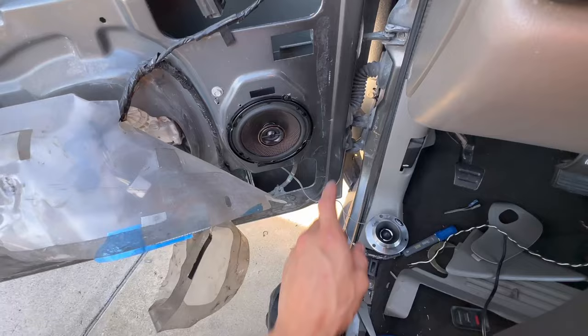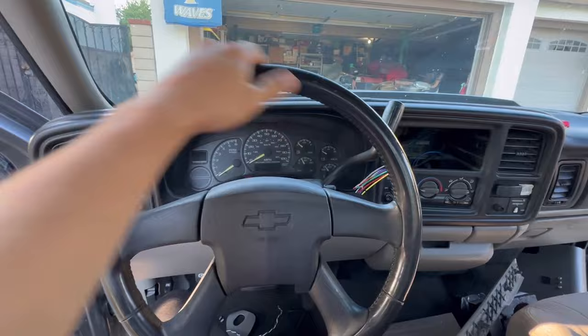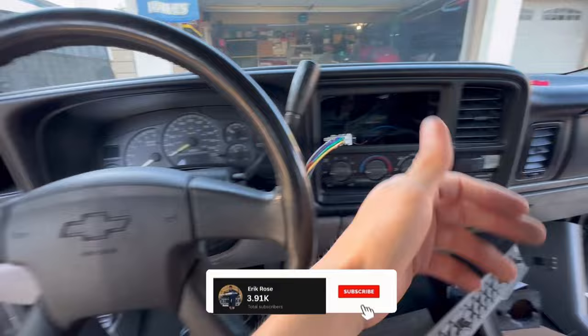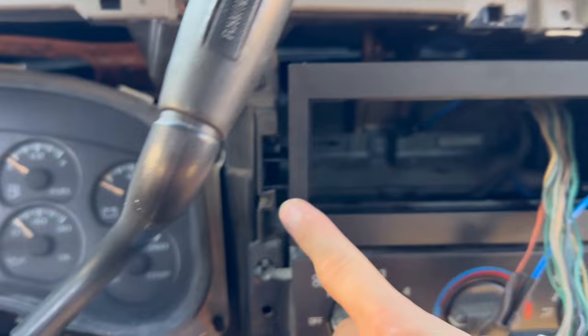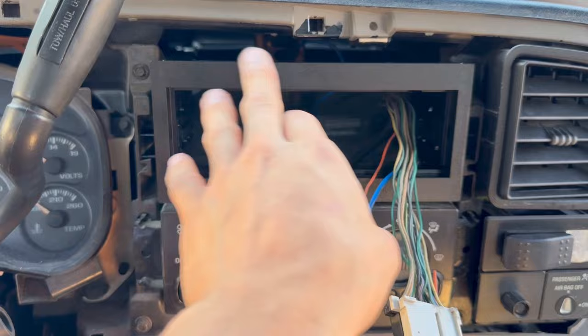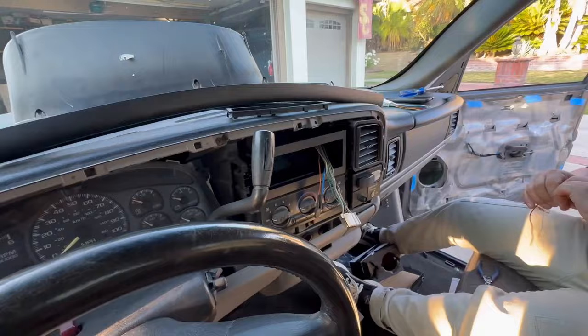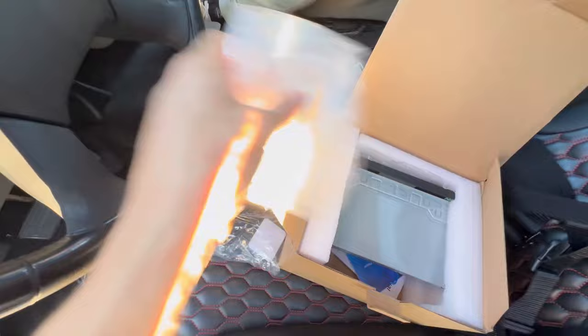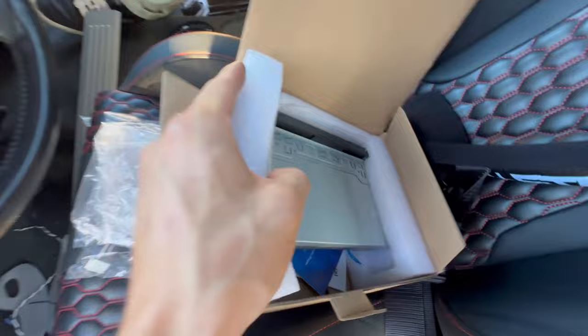Before finishing that other side, we want to go ahead and put the head unit in first, just to make sure we're good. Just got to take this plastic trim off, then put our bracket and head unit in, wire it up. Here's the bracket — it just slides right in, you really don't have to do much. Link in the description if you want to check that out — it sits nice and flush. For the stereo head unit, I went with the Apple CarPlay one. I wanted navigation and all that, so I decided to try a smart unit — if it works, it works, if not I'll let you guys know.